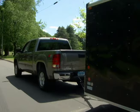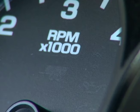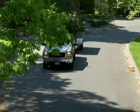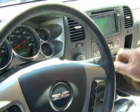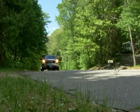Most pickups with automatic transmissions can be operated in the drive mode. Some trucks, like this GMC Sierra, come equipped with a tow haul mode that changes the transmission shift pattern to reduce cycling between gears and improve efficiency. When going uphill, if your vehicle does not have a tow haul mode, it may be useful to shift out of drive and into a lower gear.